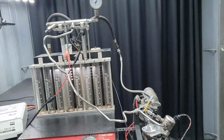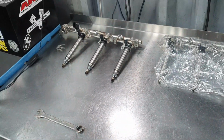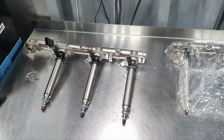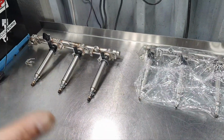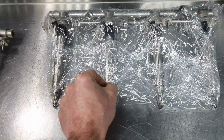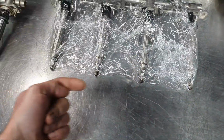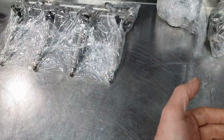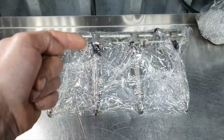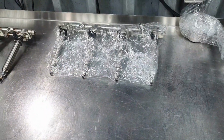You remember when I said that if, for example, one cylinder at 5000 RPM has, let us say, a 16:1 air-fuel ratio, and some others have 12:1 or 11:1, the oxygen sensor, you're going to be happy. Because if one injector is not performing well, not spraying the correct amount of fuel inside the combustion chamber at 5000 RPM under wide open throttle, the other cylinders are going to compensate, they're going to spray a little bit more, because it cannot pass through this one. The oxygen sensor, the lambda, you're going to be happy, but this cylinder, you're not going to be happy. You're going to increase pressures and temperatures much more, because you're going to be near stoichiometric, or even stoichiometric is lambda 1, 14.7 to 1.